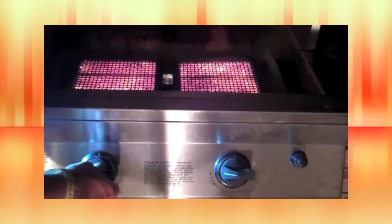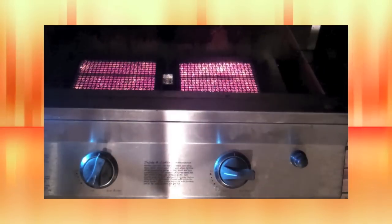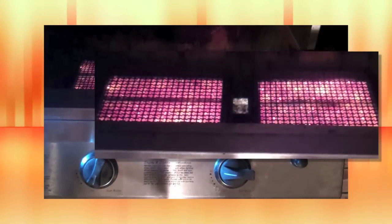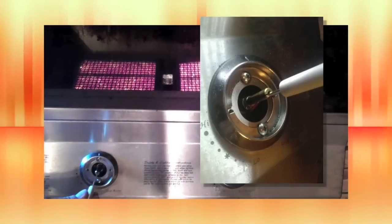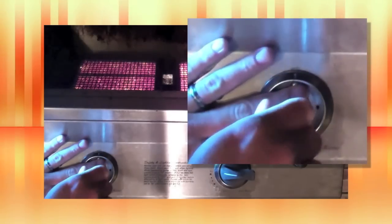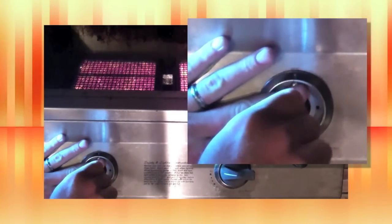Adjust gas flow through the barbecue's control valve by turning the valve to its lowest setting as seen on the infrared grill burner. Once the valve is set to low and the burner is at its lowest setting, remove the knob to insert a long flathead screwdriver and turn clockwise to make the setting lower. Hold the stem so the valve stem does not turn with the inner set screw. Wiggle the screwdriver until you can feel the flathead sink into position.